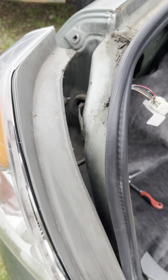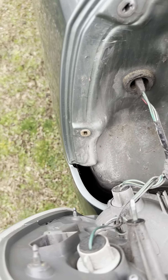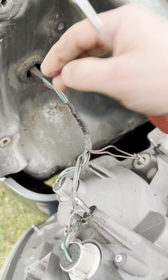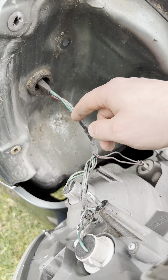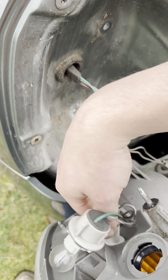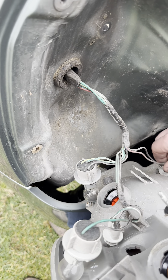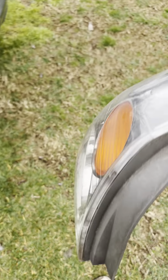To assist in getting mine out — you can see it's pretty dirty and stuck — I worked it out of the capsule on the back until she popped out. I did take that clip loose but I'm not gonna mess with it too much given how dirty it is. I'm just gonna go ahead and twist these bulbs out like so. Pretty easy to see where they go back in, and that's it — tail light's out.